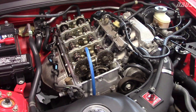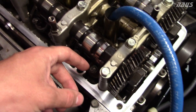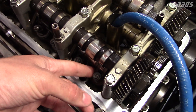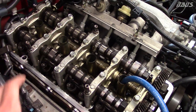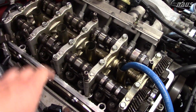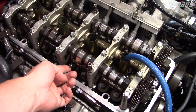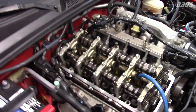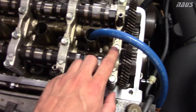I'm going to go ahead and inspect all the retainers. I have the cylinder cover off right now - you can see the holes from the leak-down tester, cylinder one on top dead center. Make sure you go through and loosen all your valves so you have a lot of slop between them - that takes pressure off all the cam caps. When you loosen these, the cams won't be trying to fly off the valve spring. Crack all 16 of those nuts loose and back out the screw so there's some flop. Then you can take the five cam caps off - they're molded with numbers on them: one, two, three, four, and five.